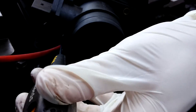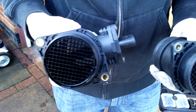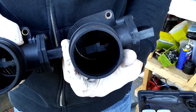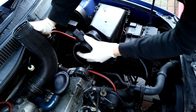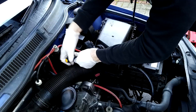These screws can be a bit tricky — just get the right size screwdriver — but they will come off. With the diode mod I felt the power coming back over 3000 RPM but it was still sluggish before then, up to about 2000 RPM. On the left is the new MAF sensor and on the right is the old one — it doesn't really look much different, so it must be the wire running inside that's completely worn out. You can't really tell the difference apart from maybe the plastic not looking as shiny and new. We're going to pop the new MAF on and stick the screws in, then do all the piping up and get some new logs.